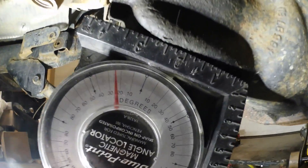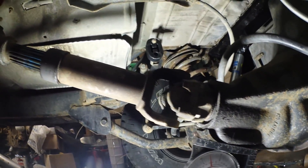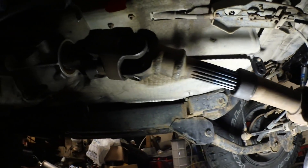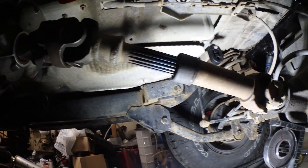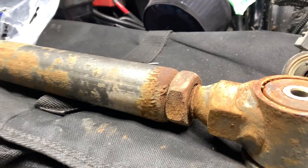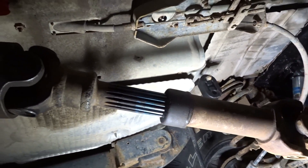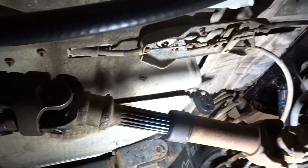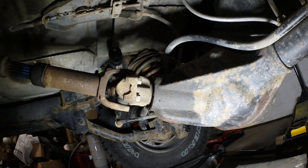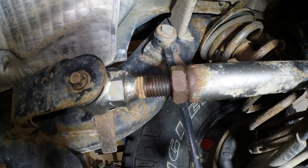Like I said at the beginning of the video, it's going to be about 20 to 25 degrees. I am at about 25 degrees right now, and as you can see, the double cardan joint comes down and pretty much goes into the differential as straight as possible - that's what you want when the vehicle is at a coast. You can see from the adjustable control arm just how much I had to adjust to get the proper angle. The double cardan coming into the differential has got to be as straight as possible, otherwise you're going to have vibration issues - vibration will take out seals and damage bearings. The control arm is now bolted down.